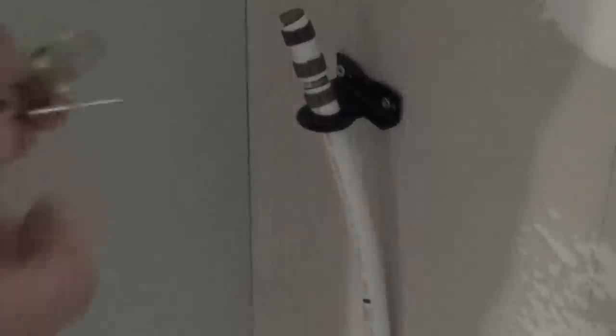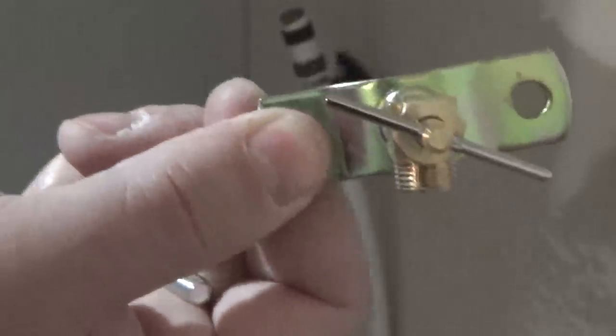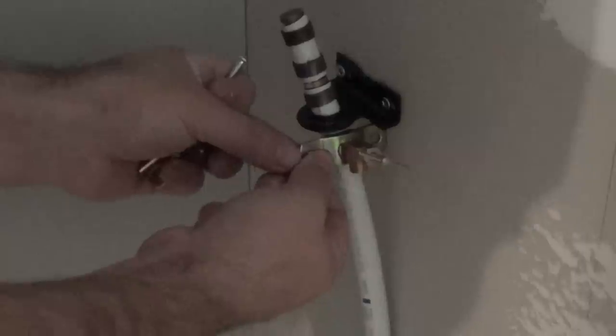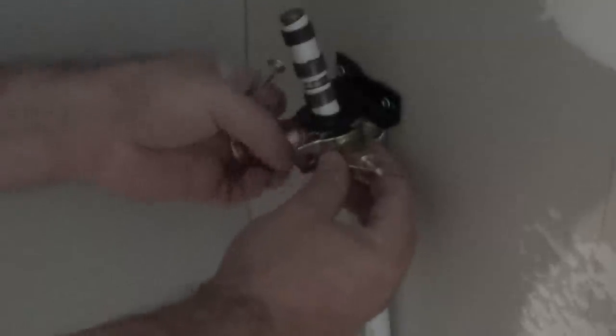An important consideration is the orientation of the valve — it's not just the valve but the bracket too. I turned the valve so that it's pointing down, so I can bring the water line out of here down towards the bottom of the fridge, since the water comes in from the bottom. The bracket sticks out a little bit so you're losing about two inches of space for pushing back your fridge, but there's no way around it. I adjusted it so that the opening is pointing down — that way the fridge won't bump into the more vulnerable part of the valve. I think we can go ahead and start to screw it on.